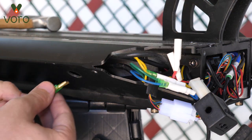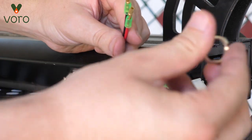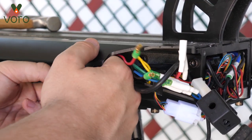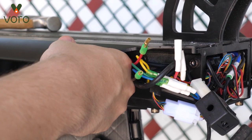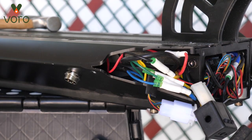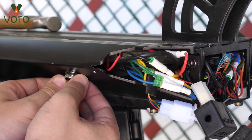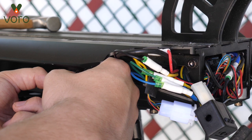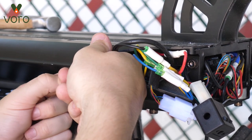Now we're going to take our new one and make sure that our green connectors are near the actual power. We're going to go ahead and put it up and into the hole, and then take that washer and put it back on and run it down the cable. Then we're going to try to spin that washer onto the power on the inside. Just feel it out, you'll get it eventually. Once the power cable is on a little bit, if you have that rubber stop still, we're going to wrap that over our power and try to get that pinched underneath the power and the board on this side — kind of like the washer but opposite. And we're just going to keep on tightening that on the inside while twisting it on the outside to make sure that it's as secure as possible.